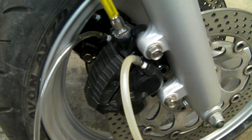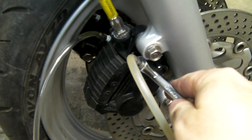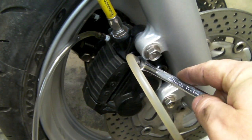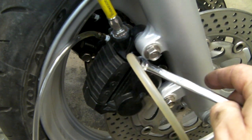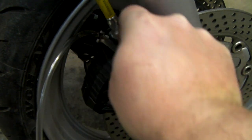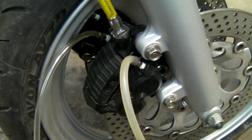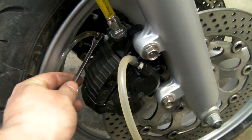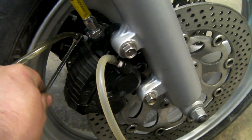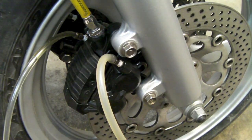I've had the lever pinned back for about half an hour and I've got a pretty good lever. There is still definitely some air in the system — how much, I don't know — so I'm going to pull through a fair amount more, probably a couple of reservoirs full, just to try and be sure I've got it all. Trying to do this with the camera right in front of me isn't easy but we'll get there.